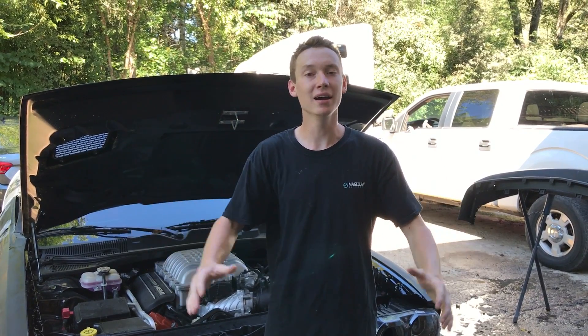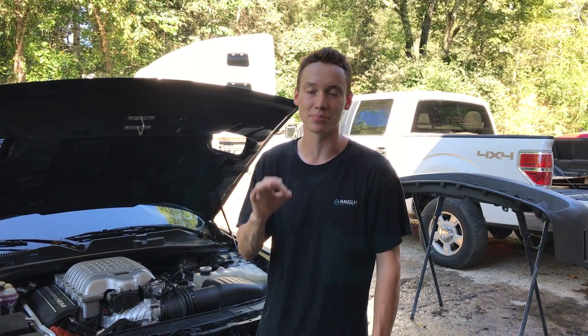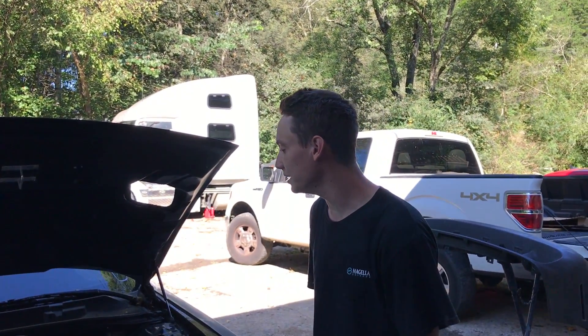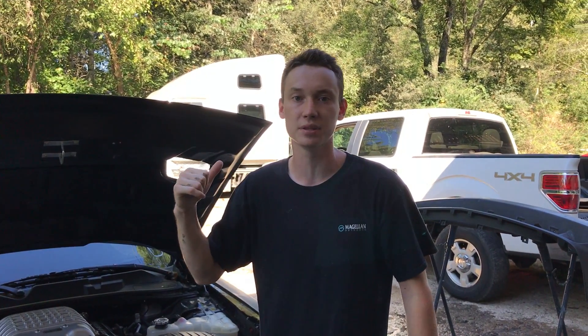The entire Hellcat is a hundred percent done with the sanding process. Everything looks really good — I'm really excited about that. That was a lot of work, a lot of time, a lot of man hours goes into sanding to get that pristine paint job. Now we're gonna go ahead and remove the hood, pop the trunk lid on, screw everything on nice and tightly, and wash this car completely down with water to get all the contaminants off before we head to the paint booth.